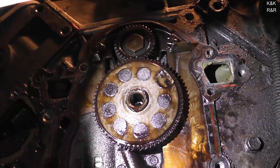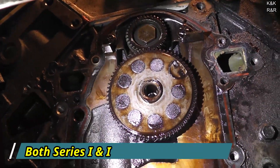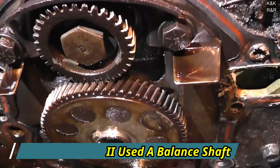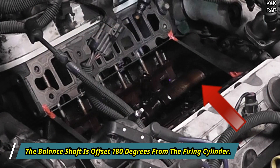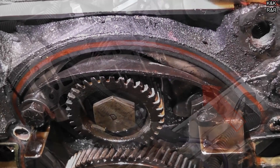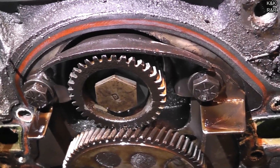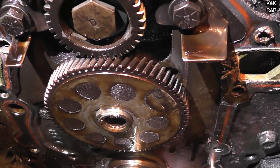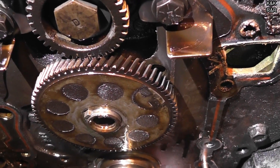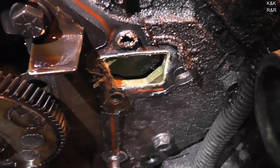To do the cleaning, I'm going to leave the balance gear on. The Series 1 uses a balance shaft — the idea is when one side of the engine is firing, the other side is thrown off. It's supposed to make a cup of coffee still, but V6s will always have a little bit of harmonic imbalance, which is normal when they're running right. Sometimes you take those off, sometimes you don't. We're going to leave this one alone — there's no reason to touch it. But the rest of this all has to be cleaned.